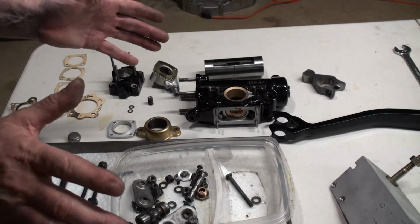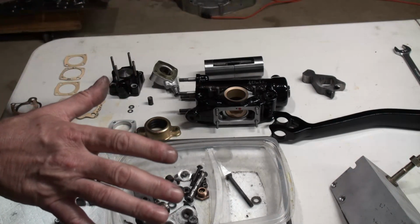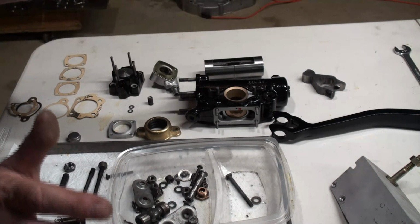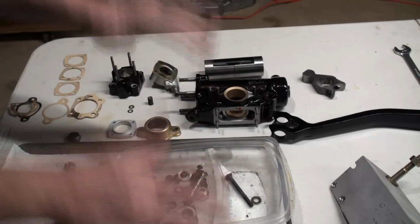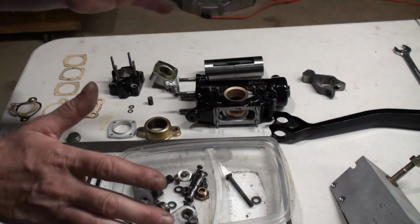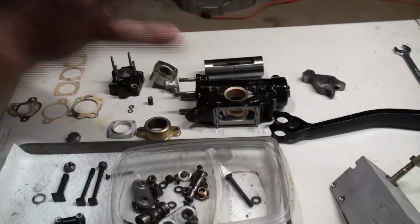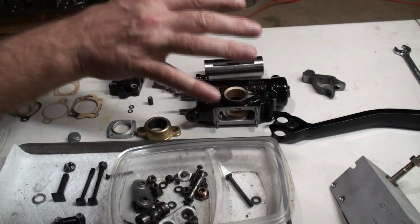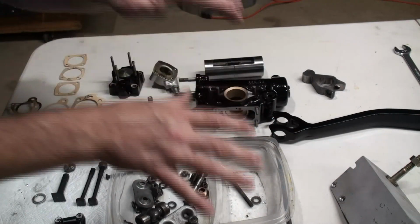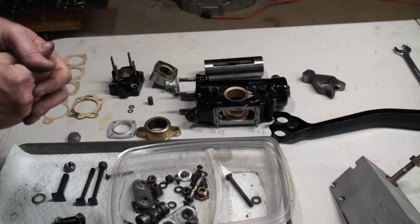And just to explain what a shock absorber does is it controls the amount of bounce that your springs have. So if you're riding along in your car and you had no shock absorbers and you hit a bump, your car would bounce and keep bouncing and keep bouncing. You hit another bump, it'll bounce even more. So the shock absorber stabilizes that amount of bounce. So right when the bounce happens, it controls it, stops it. Instead of bouncing continuously, it just brings it to not an abrupt end, but enough of an end so that you don't continue along down the road with that bouncing, because that can be very dangerous and you can ultimately get into an accident because you can lose control of your car.